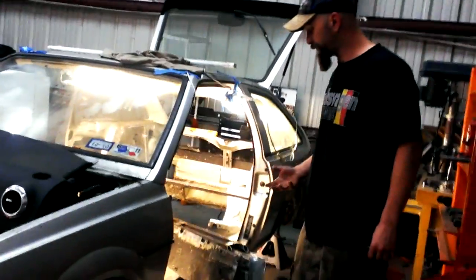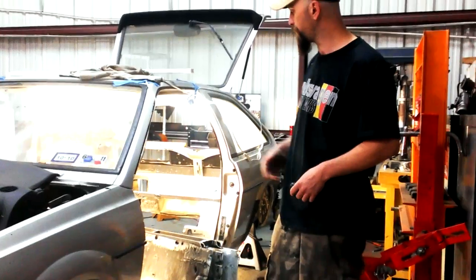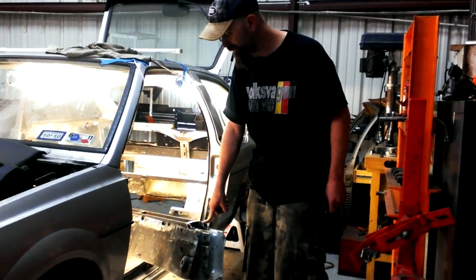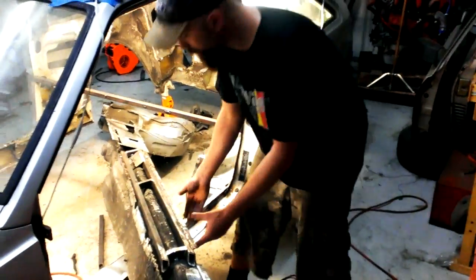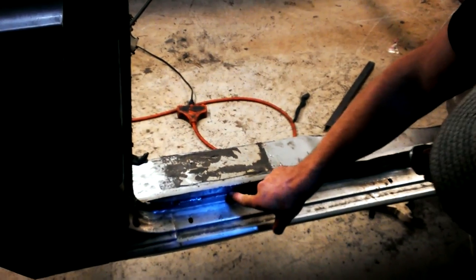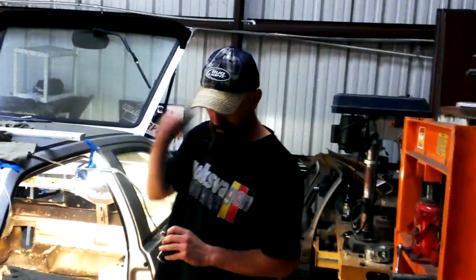I've never done this kind of swap before, so I didn't just want to weld it seam to seam, which some people said to go ahead and do. I just didn't want to do it that way. So I got 1" square stock and made a little frame on the inside. Not only is this tube stock welded to the seam of the inner frame rail, it's spot welded on the inside. On the bottom, we're going to have panels that can be held here and here. There'll be panels here as well. And whenever this frame is welded into the Scirocco, I'm welding the Scirocco to the 1x1 frame that I welded right here. So it's actually a lot stiffer. It's not just thin steel to thin steel.